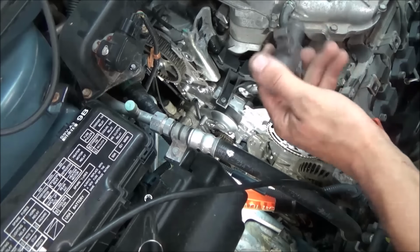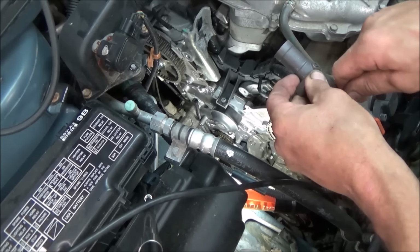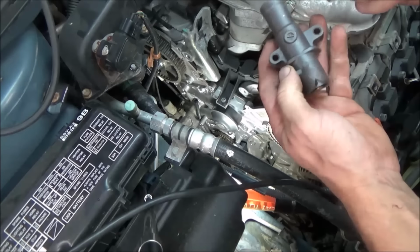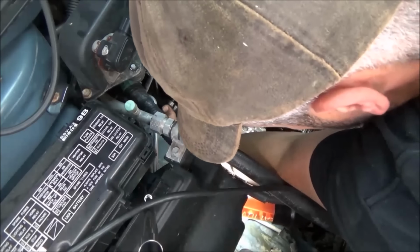Now we just got to start working backwards. I got our new tensioner here. Don't pull the pin yet, you'll be in for a surprise. So make sure that's stuck in there, and at least sticking out the back edge there a smidge. Just going to take our 2 bolts and stick that back down where it was, snug that up, and now we're in the home stretch here.